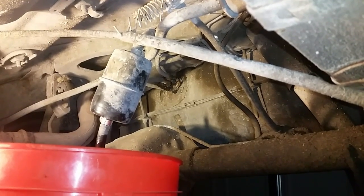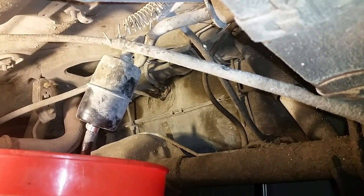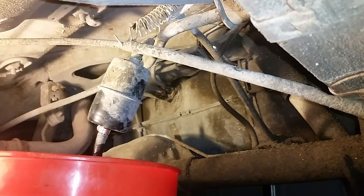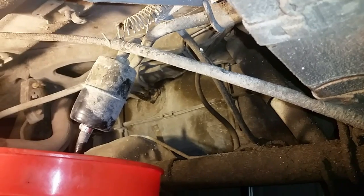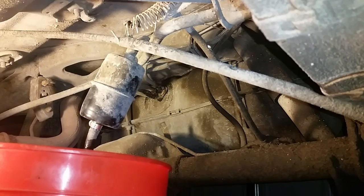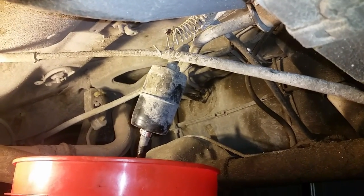I think there's a barrier or anti-siphon guard or something down there, so that didn't work out. Plan B was to disconnect the fuel filter, as you see right in front of you here, and let the fuel pump do the work for me by jumping the relay. I got this idea from Nick and Time Films, so shout out to Nick and Time — thanks for this idea, it seems to be working.